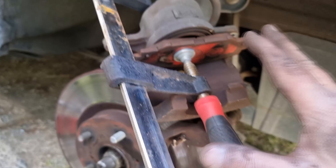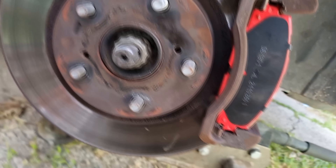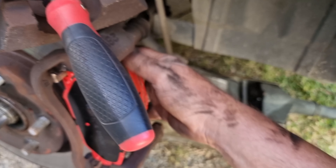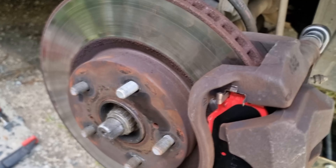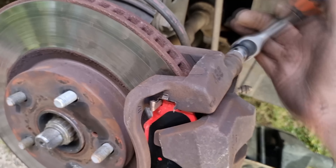There's just a 17mm on the back to get the caliper mount off, take that off, take the rotor off — easy stuff. Now I'm going to put these pads on — there we go. Same on the other side, just slide it in like that — a bit tricky to do with one hand but should be okay. Put the caliper on, then two 14mm bolts on the back just to tighten that caliper back down. I'll need a bit of muscle power to do that properly — just using a little ratchet to show you.